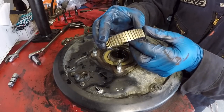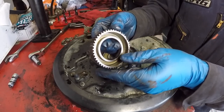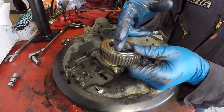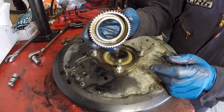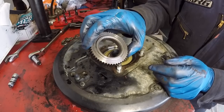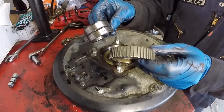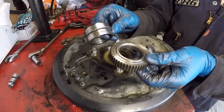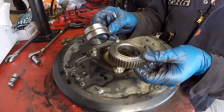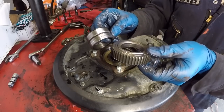You can also reuse the ABS tone ring — it's just a hunk of metal the magnetic ABS sensor reads. Unless you cut the part off, you can reuse it, which is why we pull the parts off rather than cut them. ABS tone rings are quite expensive. These two retainers and the ABS tone ring together will save you about $150 at online pricing — even more if bought from a dealership. A pretty significant savings.